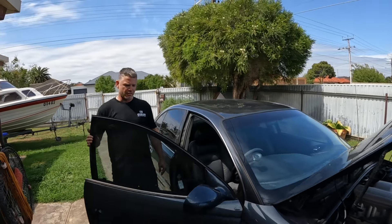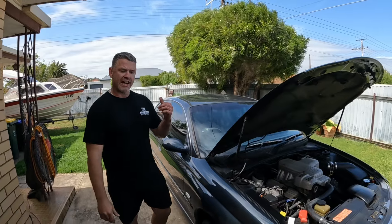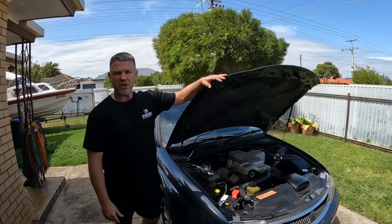Alright, that should be alright. We've rounded up, double-checked oil. Now we'll jack up the back end — it's still got a small vibration. Back in Perth we changed the centre bearing on that drive shaft and that took the thumping away, but I still had the slightest vibration at like 60-something k's an hour. So I took the shaft back out, put a VY Commodore one in there — still the same problem. Then I took one down and got it balanced and that was out by about 5 or 10 grams, nothing to write home to Mum about. But anyway, Safety Grandpa's done the Nullarbor and I can still feel that vibration — I can hear something's not right in the back end. So we'll jack it up and have a look.